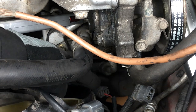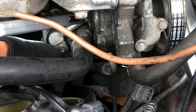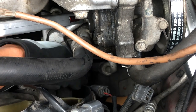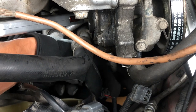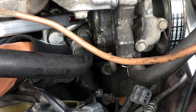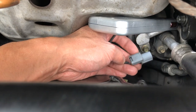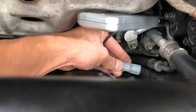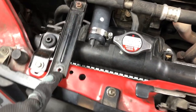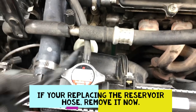For this connector on the bottom, this is also connected from the fan, but it also goes to the AC compressor. There's also a bracket here, and at the bottom of the bracket there's a little clip. You want to push that away from the fan and it should come off. But before that, you have to remove this electrical connector — press the tab and pull it. There's a little clip in the back — push it down and it comes off. There's another connector from the AC compressor: press the tab down and pull it away from the fan going down. With that removed, just pop the sucker up and switch it to the opposite way so it doesn't bother anything later on.